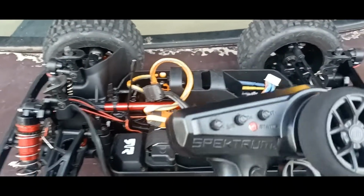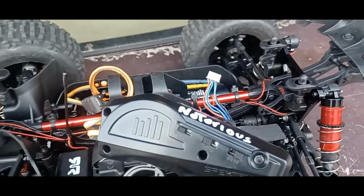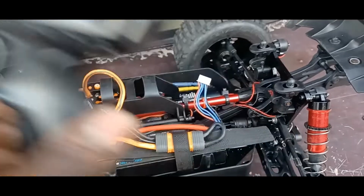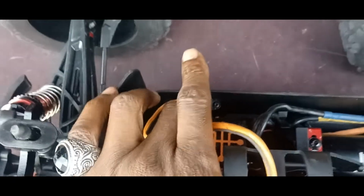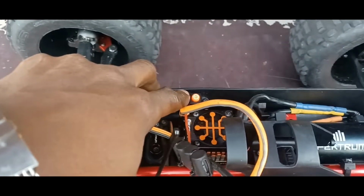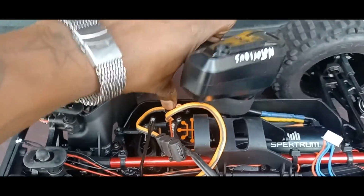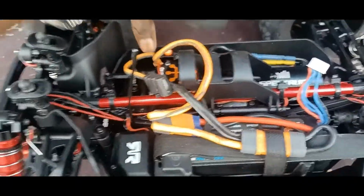And what you do is cut the remote on. I like to leave it at 50%. For some odd reason, when you start it from 50% and calibrate it, it seems a lot faster. So when you calibrate it, hold this button, power on. Push it once. Now in calibration mode, full trigger. Or reverse.